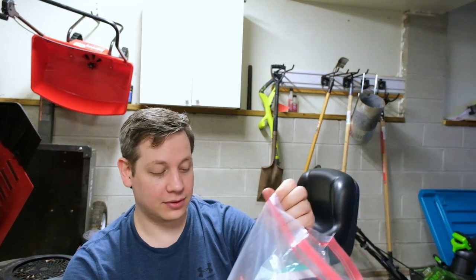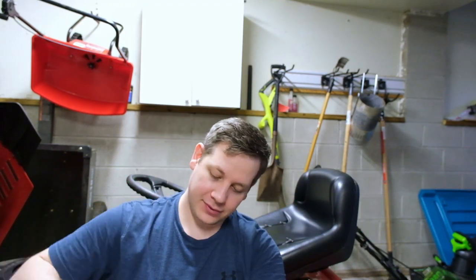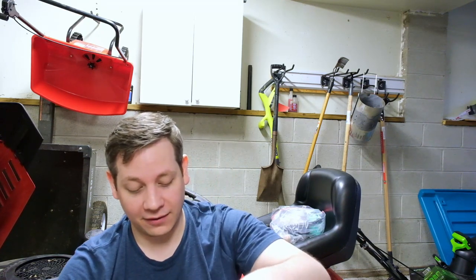It just has the direction that the fuel flows. We've got an air filter in here that actually does look correct for this model — it's got the pre-filter and the air filter. And then for $16 I also got an unbranded Savior spark plug. If you've held spark plugs before, they have a kind of a feel to them. This one feels cheap and plasticky on the portion that's normally ceramic. I saw that and immediately got suspicious — I've never liked using off-brand spark plugs, I've always had bad luck. So I bought a Champion one too — I ponied up the $10 — and sure enough, night and day difference between these two.